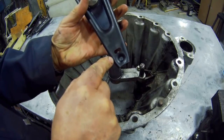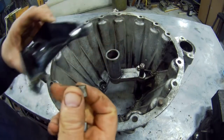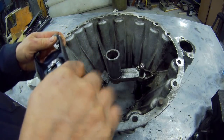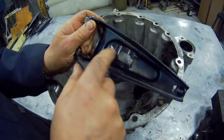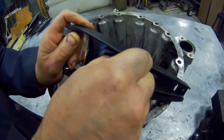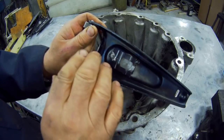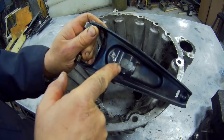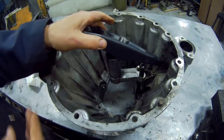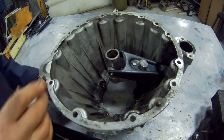First fit your push rod and the little clip, and then once that's all greased up, put your slippers on and fit it. Whenever you fit these clutches — even if it's not one of mine — just make sure you tease these forks back a little bit. Make sure they're not too flat; they should be sticking up a little bit. If not, you'll have a hell of a time trying to fit this. Just offer it down, look down, and clip it in — and that's it, it's clipped in.